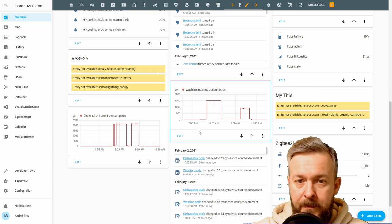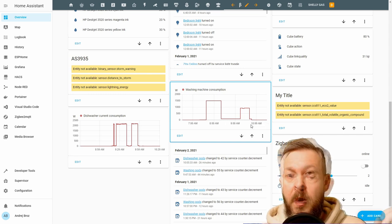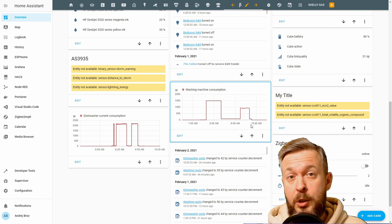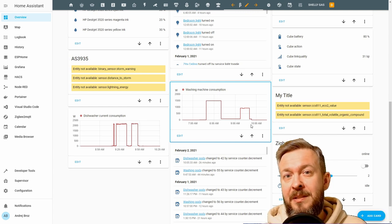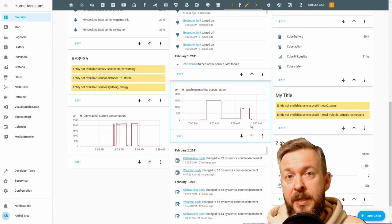The same thing goes for the washing machine. When it starts, it begins with a very low power consumption of around 8 watts, then jumps to 1500, drops to 93, jumps to 900, and then slowly drops. The lowest point for my washing machine is 1 watt, which means the washing machine has ended but is still in some kind of standby mode. So I can track if the power is below 2 watts to know the washing machine has ended, even though I haven't pushed the button to turn it off.